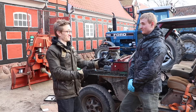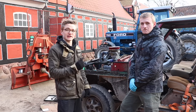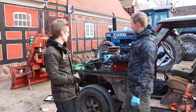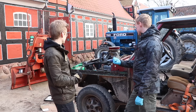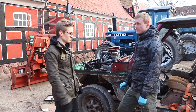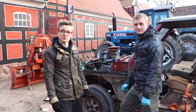So there we have it, another day and more bits and bobs added and fixed to Project Bob. He's now going to get an oil change — we're not going to bother filming that because we did it in episode one, so check that out. We've got water in the oil so we need fresh oil in there. We got the new fuel pump in, got rid of the mechanical one, got the belt adjusted so it just runs around nicely, and got it running a bit better by setting the fuel level correctly. Going to put some new fluids in and drive it back, then take it out tomorrow for a test drive around the woods. That's it for this episode of Project Bob — if you enjoyed, leave a like and subscribe, thanks for watching and we'll see you in the next one.